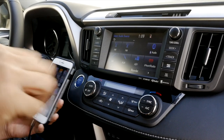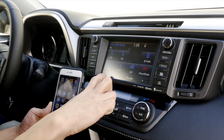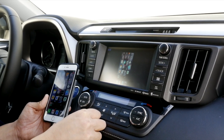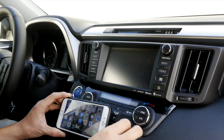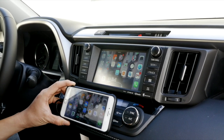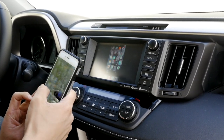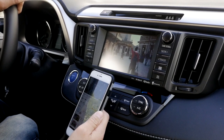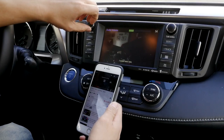Now that everything is back to normal, let's test to make sure everything is in working order. You'll notice a new icon labeled AV — if you can't see it, scroll along the bottom and it should appear. Touch AV and the phone will be mirrored. You may notice some empty space on the sides — it's not true full screen by default. To fix that, touch screen format, select stretched, and confirm. Now you have the true full screen. A quick sound test with a YouTube video confirms everything is in working order.